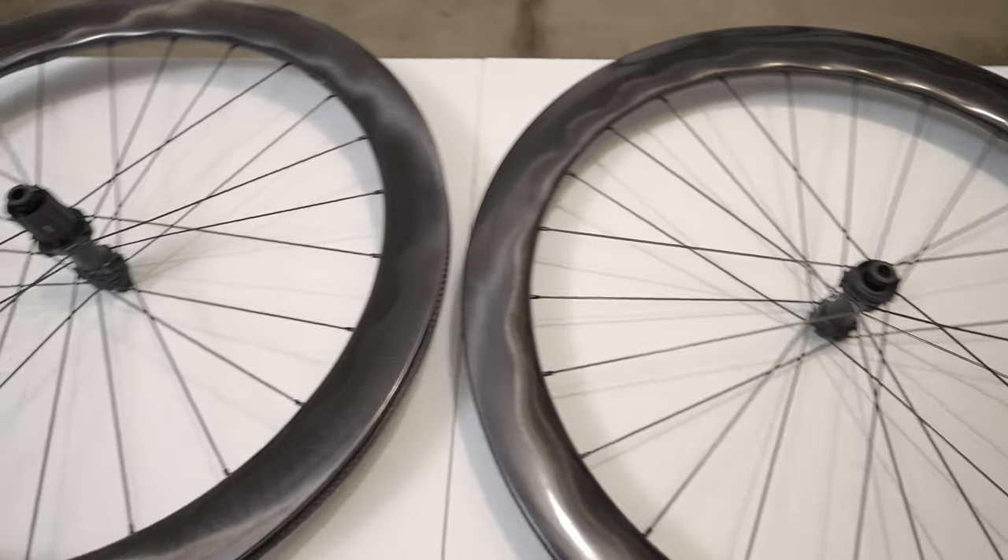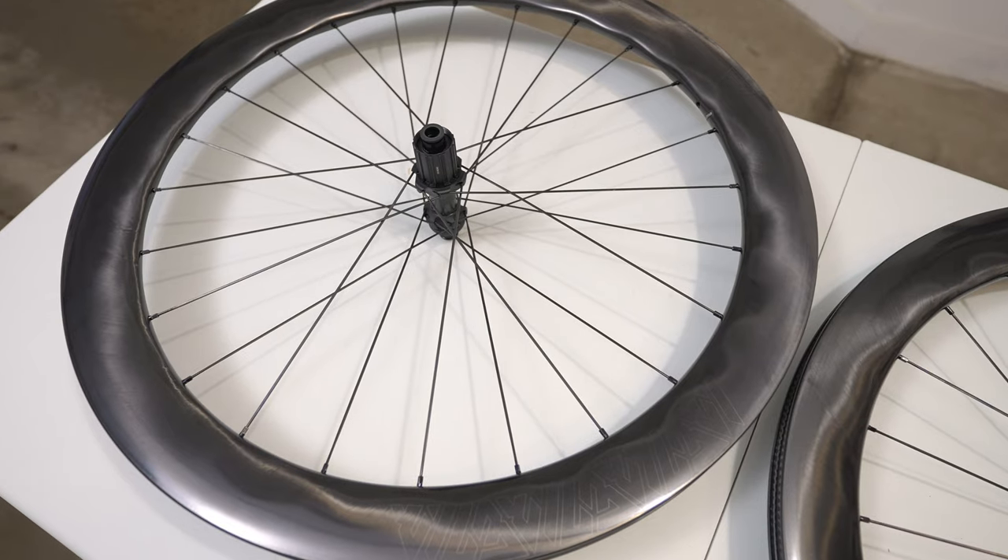Let's look at my final set of wheels. As for the weight, I mentioned in my previous video that I wanted these wheels to be sub 1450 grams. The DT Swiss spokes calculator gave me a weight of 1415 grams for the complete wheel build excluding accessories like the valve, rotors, cassette and tires. I weighed both wheels on two different precision scales and the weight came out on both scales to exactly 655 grams for the front and 745 grams for the rear, for a combined weight of just 1400 grams. That's just 42 grams heavier than the Zipp 454 NSWs, though my weight is measured while comparing it to the Zipp's claimed weight, which may not be its true weight.